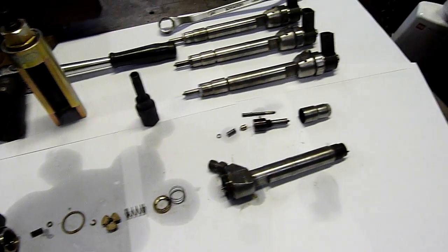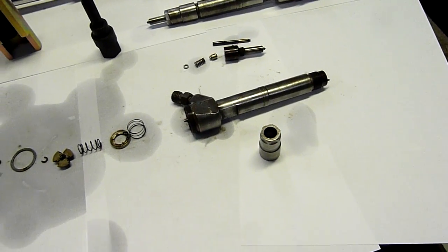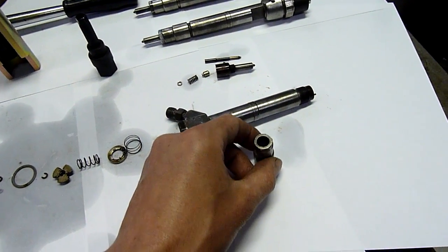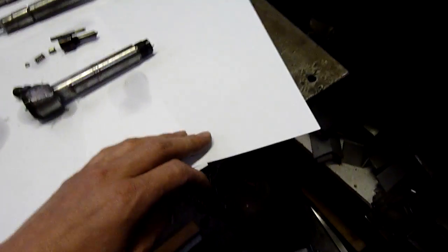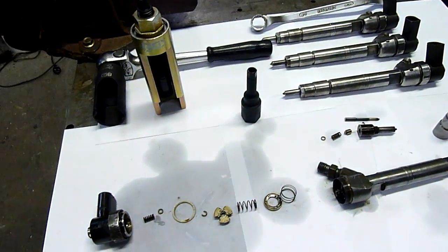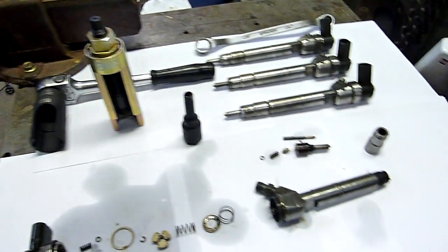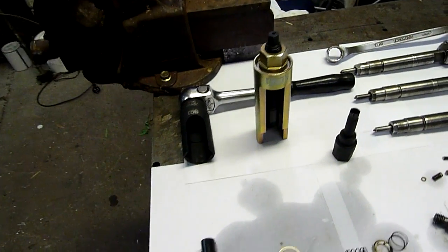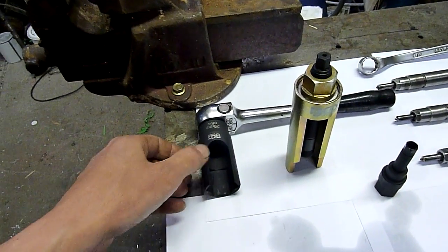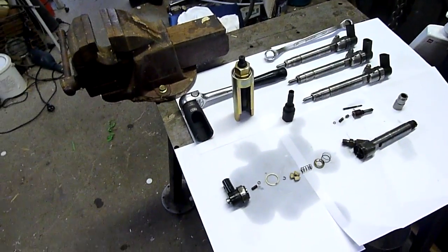When I say black death, I mean the copper O-ring — the copper seal on this end of the cap leaks combustion byproducts past the cap and out around the injector, fully carbonizing it into place. It's basically setting it in carbonite like Han Solo. Nothing short of a miracle can free that one up. So if you hear of a Mercedes with black death, be prepared for a bit of work if you buy it. I knew what I was getting into. I bought the tool set for $30 — somebody bought it, bought the wrong one, then relisted it on eBay. Cheap. They're actually quite expensive if you buy them from the store, but I got lucky.